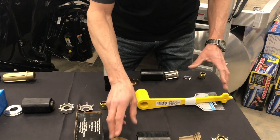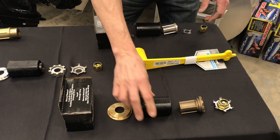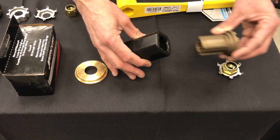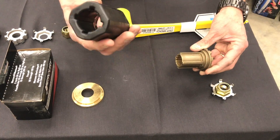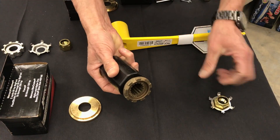There are usually four components to a hub kit: a thrust washer on the back side, you have the insert, and you have the piece that connects into the insert and to the prop shaft itself. When these two have an argument, usually the plastic or the Delron sleeve by Mercury will fail. This is meant to shear away and shear out when it does fail because it is interlocked like that.